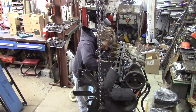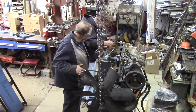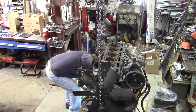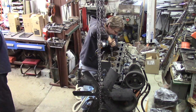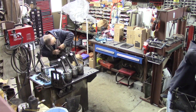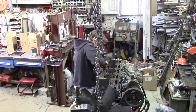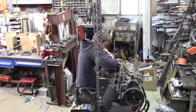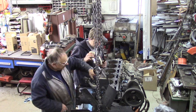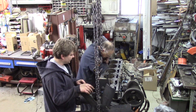The next step was to clean up the bores. There was an awful lot of rust in the water jackets, and some of that stuff was falling down on the crank — which is no good. We used a big wire wheel, turned it slow with a vacuum cleaner handy, just cleaning them out. While I was doing that, dad was pulling the C-clips off the pistons and getting ready to remove the rods. After vacuuming everything, we hit the top of the deck with a sander.